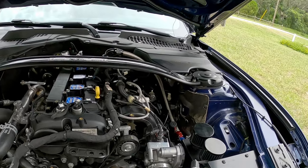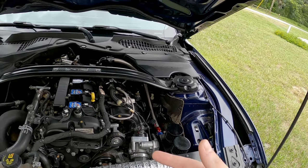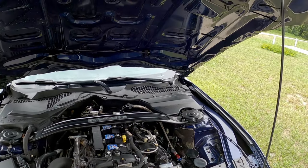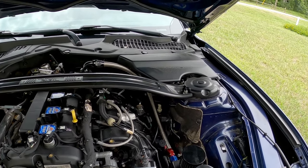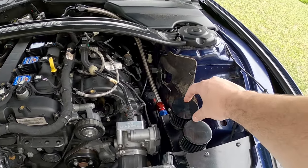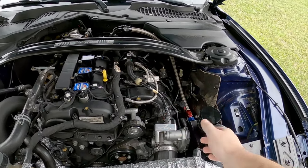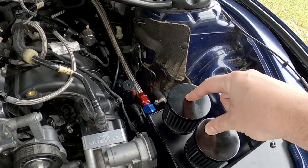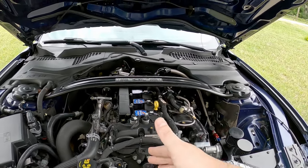I don't know if it's going to work, but we're going to find out. I'm hoping when the car is under vacuum — which is a lot of driving; when you're cruising or idling you're mainly in vacuum — the vacuum will be strong enough to suck those vapors through so they don't come out here and instead get sucked back into the engine. But when I go wide open throttle and it builds a lot of boost and pressure, those vapors will go out of here via path of least resistance, venting the engine really well. When I'm idling, I won't get gassed out. I've got to undo some of this work and get these new lines put on.